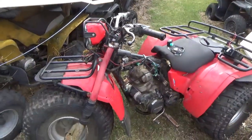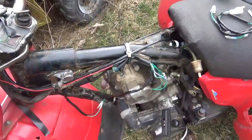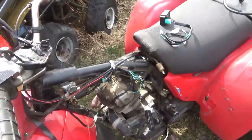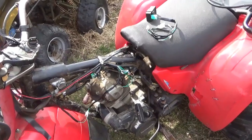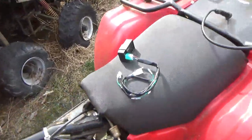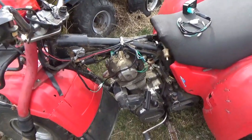Once you put this all together, I think you'll be surprised at how well it runs and how easy it is to start. For those in the more advanced class: there's a mechanical advancer in here. When you go to start, it's in delay mode — it delays the spark a bit, then advances as RPM increases. The new CDI is also in delay mode at startup, so you have a double delay. That actually makes it easier to start — it won't pull back and jerk your arm. As RPMs advance, the delay goes away, the mechanical advancer kicks in, and you're right back to full performance.